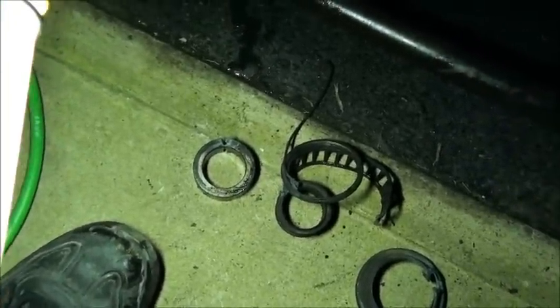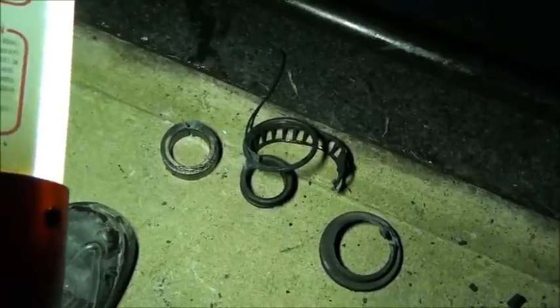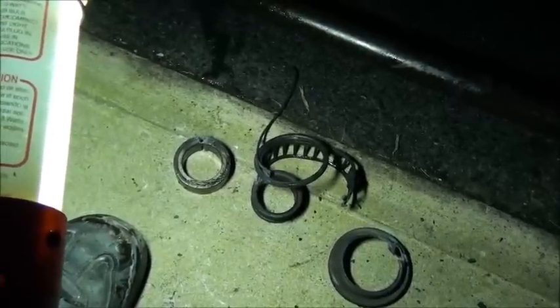Boys and girls, it's starting to rain on me. But I cut this off - right here, if you notice, is the outer band, right there is the band of the actual bearing. You've got to destroy the bearing, and I actually nicked the seal at the same time. My retainer cap is a little warm - it's out there in the driveway, it's raining so it's cooling off. The reason I did not show this process is because if you don't know how to use a torch, you do not need to try to do this. You can destroy your axle. 31-spline, 9-inch Ford truck axles are not cheap. So I'm not going to be the reason for you to destroy an axle. You cut - you don't even necessarily have to cut all the way through, you just got to relieve the tension. You can cut partially through, halfway. A lot of times hit them with a good sharp chisel and they'll break. You can cut them on both sides halfway through, pop them with a chisel, and they'll break off in two pieces.